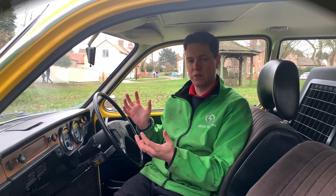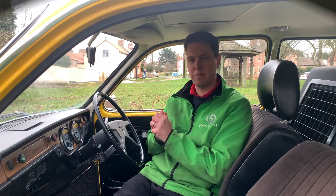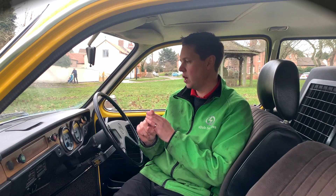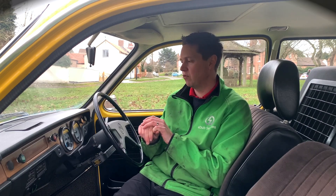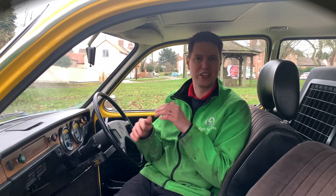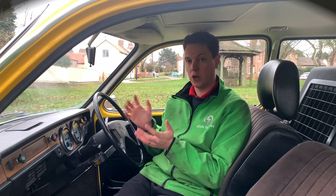On this particular arrangement there are only two or three changes to the original Variant dashboard. The two dials have been made by a company in America called Speedhut — configured to show your miles per hour with a tripmeter. You've also got your battery level and state of charge; in this conversion you'll get 100 miles of range, so 100% equals about 100 miles remaining. We've also got a power gauge displayed in amps showing how many amps you're using to drive, and it also shows how many amps you're gaining back from either regen or charging — so you can see that charging is working at a decent rate. Finally there's a motor temperature gauge, which is one of the first diagnostic tools we put on our dashboards.